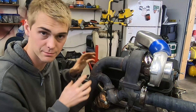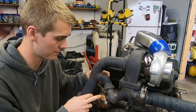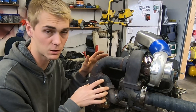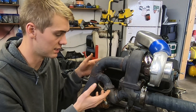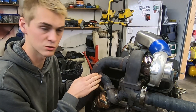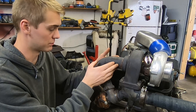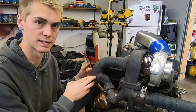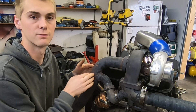One of my big flaws with this kit is I made this a hard mount to the wastegate. When I tack welded everything together it lined up great, and I burned everything in all the way around so it wouldn't leak — and then all of a sudden they don't line up anymore. That was a big issue. If I were to redo this, I would put a little flex joint in here. And when I rebuild this, the turbo outlet would end up being 3 inch or 4 inch even, because this is way too much air for this little pipe.